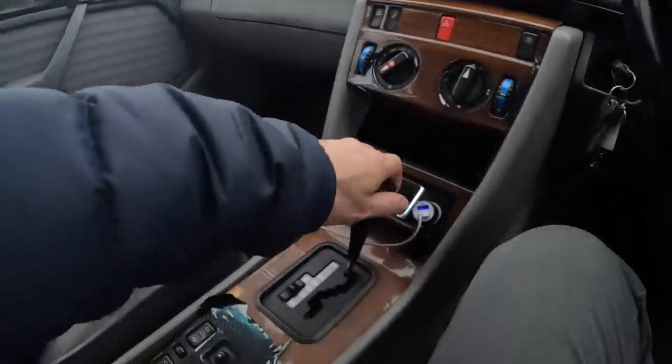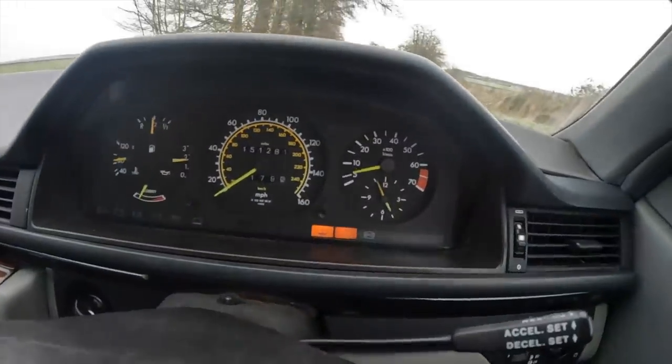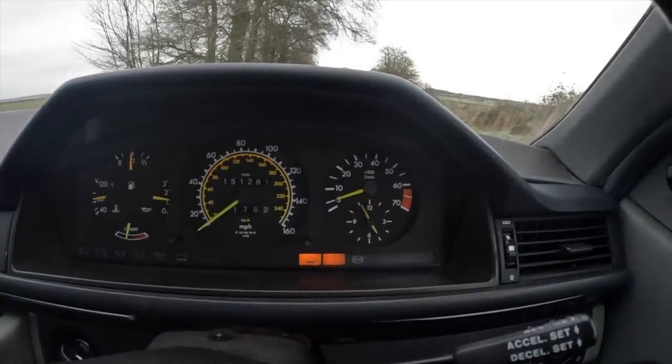The idle issue is that it runs pretty well in park or neutral at around 600-700 revs, but the moment you put it in drive it drops to about 500 and feels like it's struggling. Even at idle you can feel a tiny bit of lumpiness, but Jasmine definitely didn't think that was actually a misfire as such — she definitely thinks it's vacuum. Interestingly, when it's cold like this it actually holds in drive much better, not stumbling as much as it normally does.